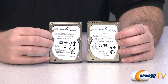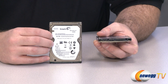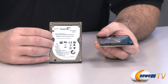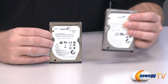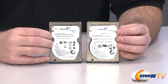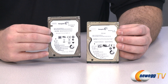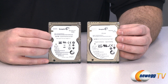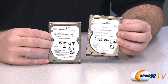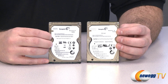The differences between these two drives, particularly with the 750 gigabyte upgrade, is you are moving up to a SATA 6 gigabit per second connector — pretty much the updated standard now for SATA connectors — so you get a bit more bandwidth from your data connection. Also, whereas the 500 gigabyte version has 4 gigabytes of NAND flash, you get 8 gigabytes of NAND flash for the updated 750 gigabyte version.